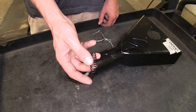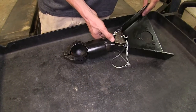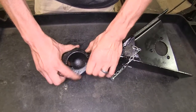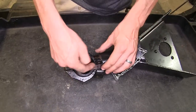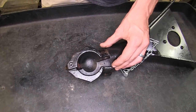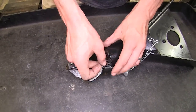Here's what our replacement spring works like. We'll flip our coupler over here and show you what this is used for. The spring is what pushes open our coupler so it'll lock down into our ball. What you need to do to get it out: just grab a hold of it, remove it, take your new one, push it in the hole, and push back down.